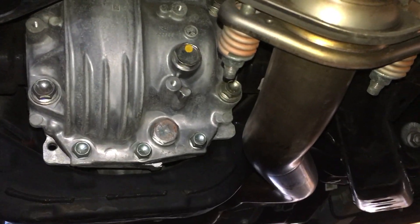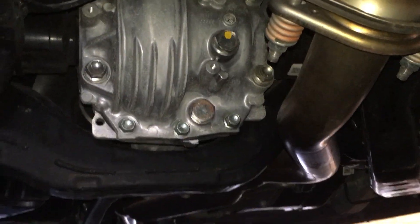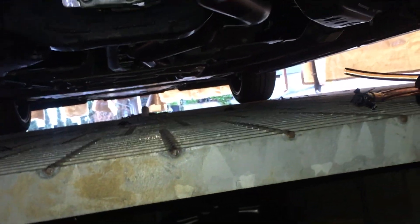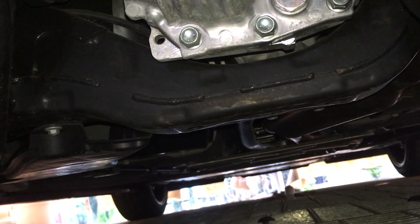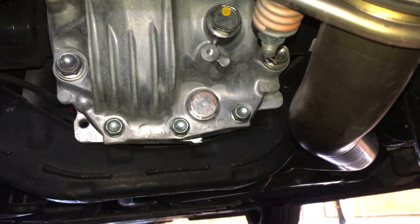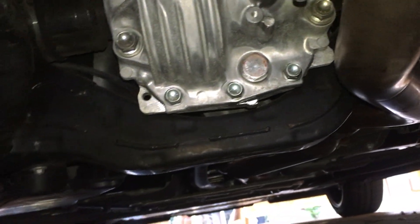So that's draining and filling the differential on the Miata — really easy, anyone can do it. If you don't have a lift like I do, you'll have to improvise. If you're really skinny you could maybe crawl underneath, but it's a tight fit. Or you could park it up on rhino ramps and maybe level out the car by jacking up the front end or putting some boards under the front. To fill it properly it has to be level. Alright, that's it — thanks for watching.